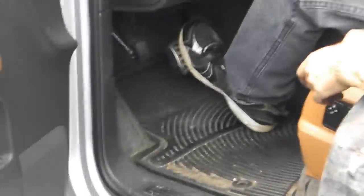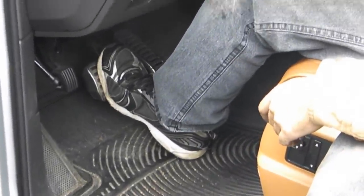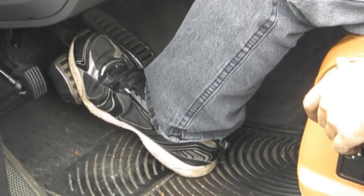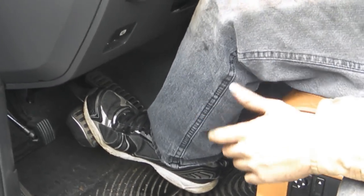Now that we have completed the brake job, one last step: you need to press the brake pedal. Do that like so — halfway, back, halfway, back — and keep doing it until you feel the resistance. Eventually you get to a point where you can't push anymore. And that's it.